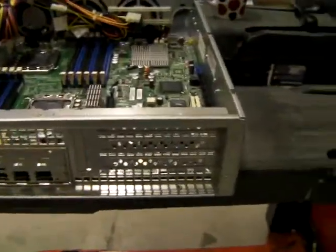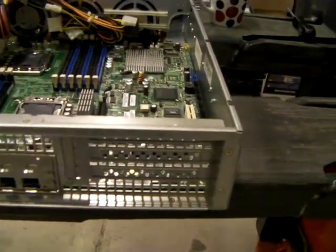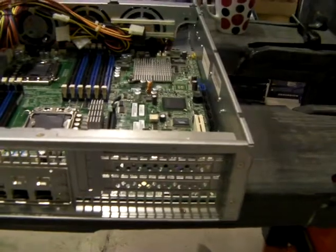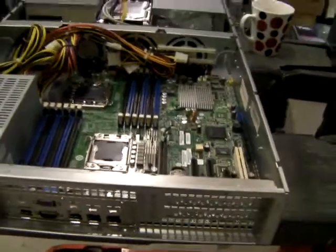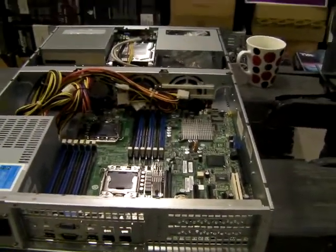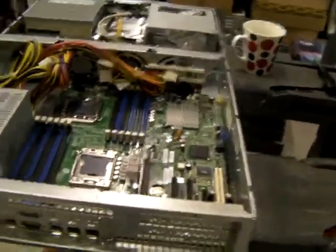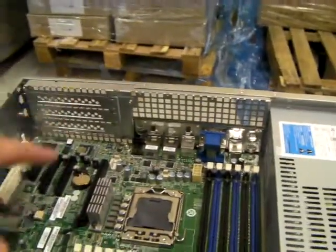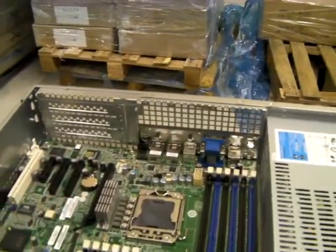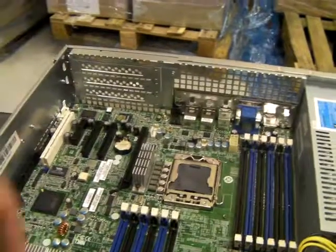This particular one has three full-height horizontal expansion ports. Generally we use the version that has five low-profile slots, mainly because most things nowadays you can get in low profile — video cards, RAID controllers, even sound cards. The reason this one has horizontal slots is we're going to put a riser card and a very long video card in it, and he needs the length.